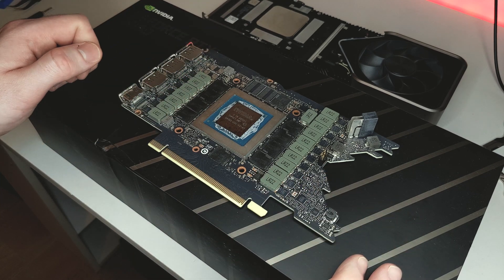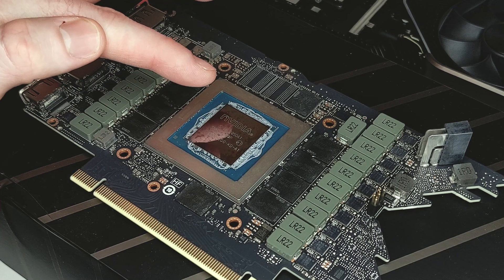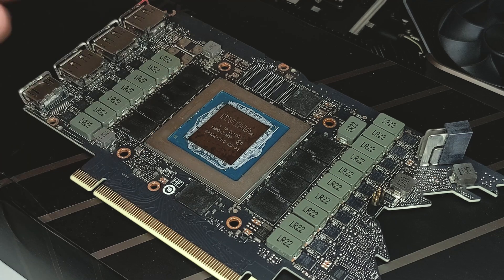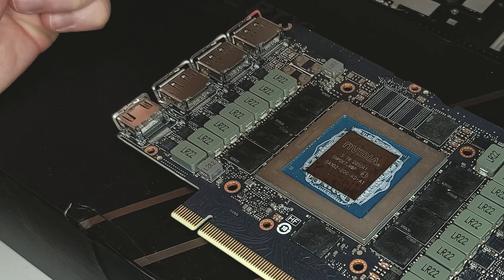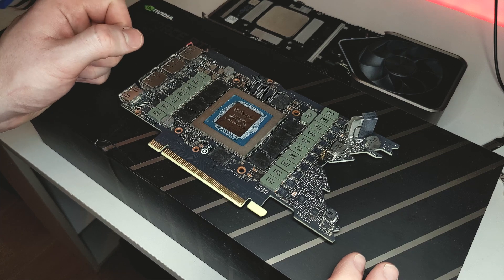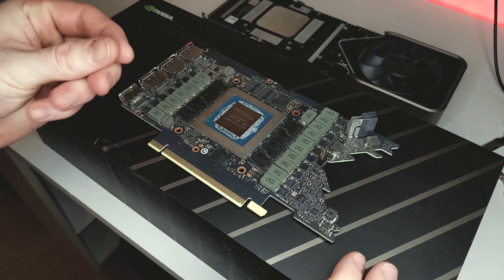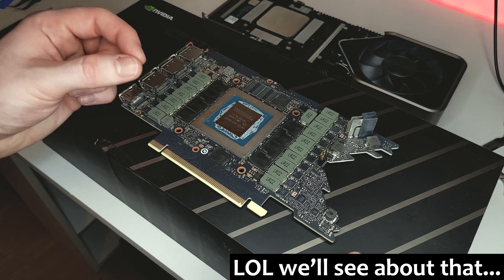While we've got this disassembled, I thought we'd take a little look. We've got our GPU die here — our GA102 200 die. This is the same die that you would have on a 3080 Ti, 3090, and I'm assuming the 3090 Ti as well, though it's a bit more cut down. And we've got our GDDR6X memory modules here, which are what's getting pretty hot under load. You probably saw when I was removing the pads that they have a very fabric-y sort of design — they work, but they're not the best. Hopefully with the Gelid pads they should be much better. They're more of a putty feeling type and quite squishy, so we shouldn't have any issues with mounting pressure when we put the cooler back on.